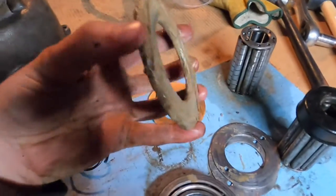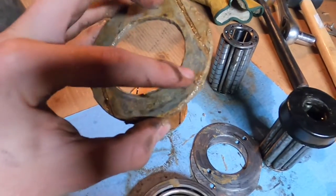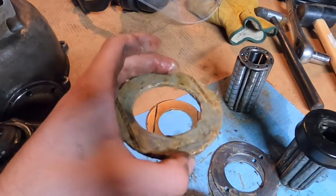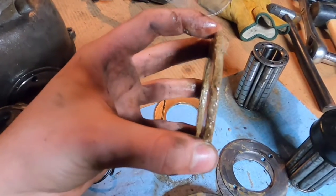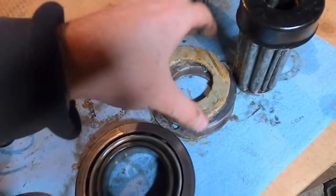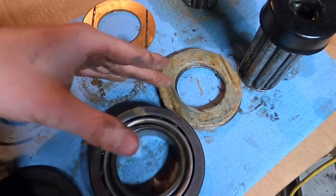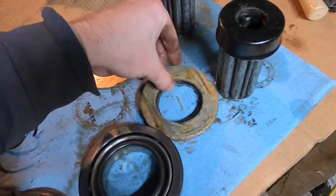The other situation is the thrust washers. This is the original thrust washer — it's babbitt material, which is great for a bearing surface but not used like this anymore. This washer is almost 100 years old. Surprisingly, this one isn't worn much — just chipped — unlike the ones in my axle which were really worn. You don't want to reuse these because the material is very soft and easy to shatter when old. It develops stress cracks and can completely shatter with just a little jar.